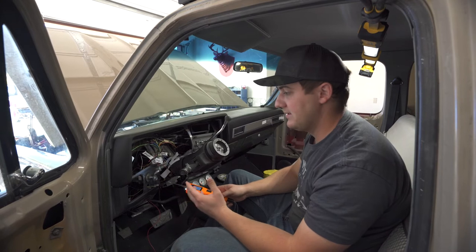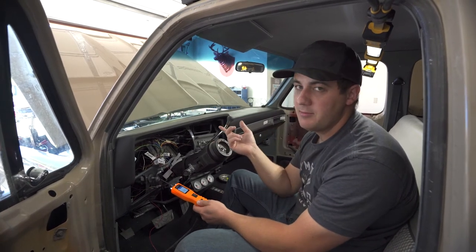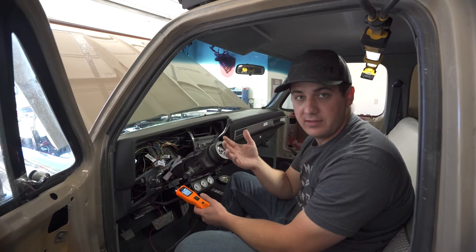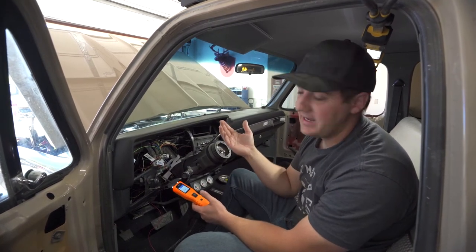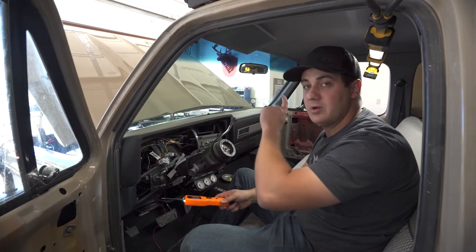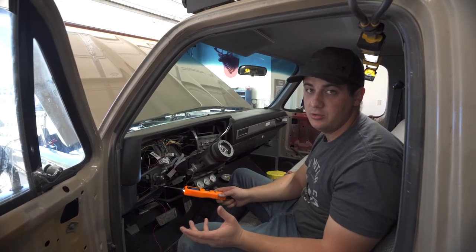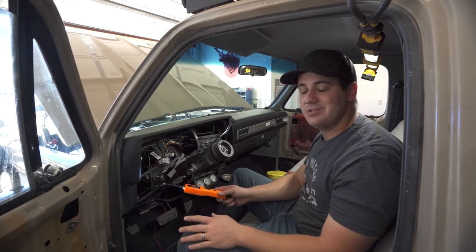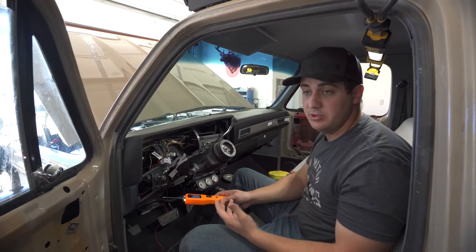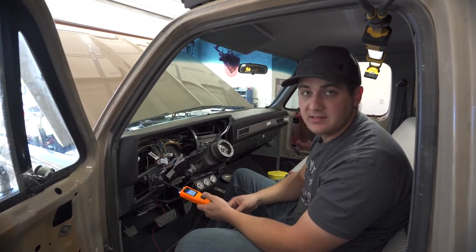Once that's all said and done, we just go through and butt connect everything in and wire in our harness. Before we do that — really quickly, for tachometer, I'm doing a Cummins swap in this truck. If you're wondering how to get tach and you don't have a tach output from a distributor because you're doing a diesel, you can buy from Dakota Digital — they sell an interface unit that will transfer a W wire signal from your alternator and change that into a readable signal that any gauge cluster can use to read as tachometer signals. It's called the Dakota Digital SGI-100BT. It's a great product and you can use it regardless of what gauge cluster you want to use. So let's butt connect this all in and see what it looks like.